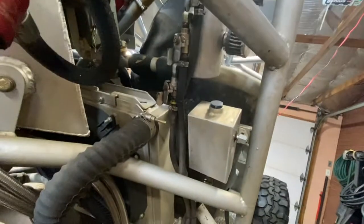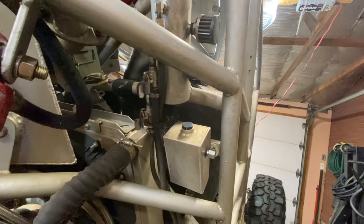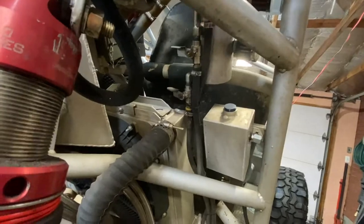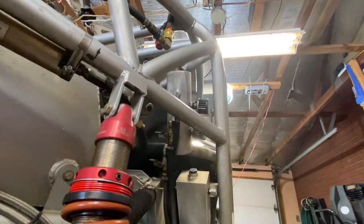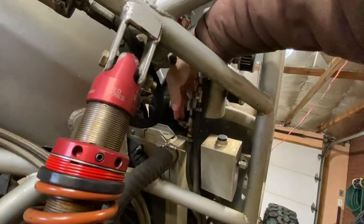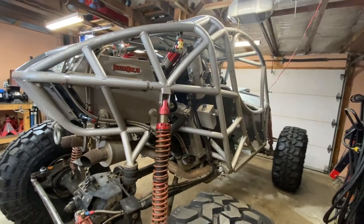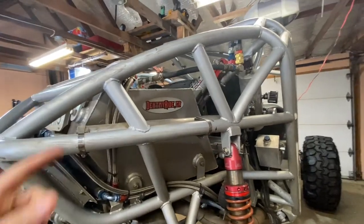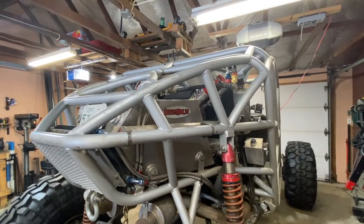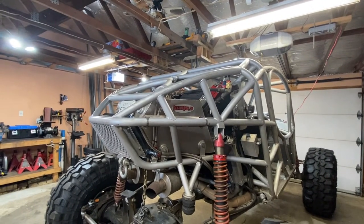In the event of a rollover, I have never had to do anything for the fuel tank. What I do is first turn off the manual valve for the PCV, then I come out of the buggy and turn all the catch can valves off. Once all these valves are turned off I don't have to worry about any fluid leaking from the buggy. This has worked really well and I recommend you do the same. There are different methods — some people use the three-sides-and-down method — but I've had really good luck with this approach. Either way, it's very important to have fluid containment in the event of a rollover.